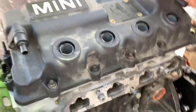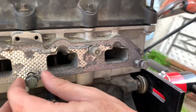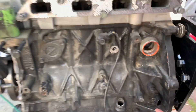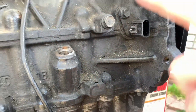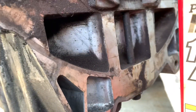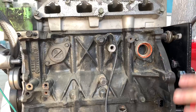I noticed on some vehicles the R53 head has studs — this has bolts. But there are also two Allen and other hex bolts mixed in. I don't know what this guy did, it's just not good. This does have an oil leak at the crank position sensor — as you can see, it's a source of the leak. Luckily the rear main seal is in great condition, actually. No leak, no seepage, no nothing. So the main sources of leaks are going to be the crank position sensor — we're going to replace all that — and then the power steering that's on the car.